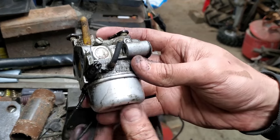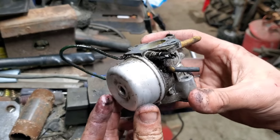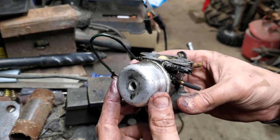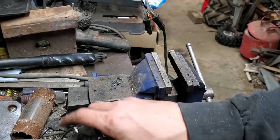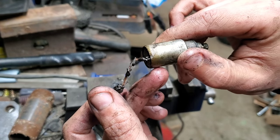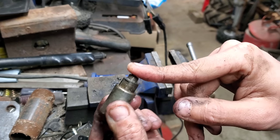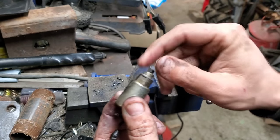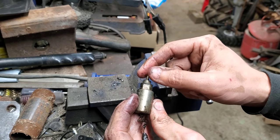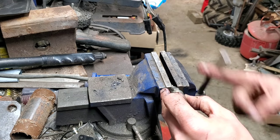This is why Kohler singles love to light themselves on fire. This is an actual Walbro carb — so this is legit — and somebody has already replaced the bottom of it. My bet is they were trying to fix the fact that these just plain do not seal up. And there is our beautiful solenoid — that one little itty bitty strand was all that was setting this thing off. What we're going to do is take this off, clamp this right into the vise, and cut that off, because we don't live in California so we don't need that in our life.